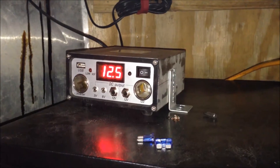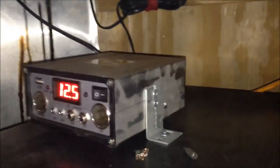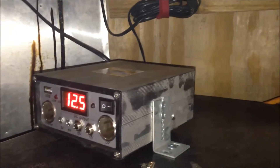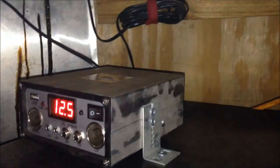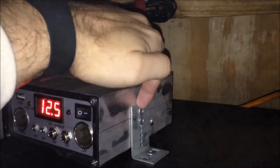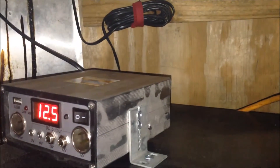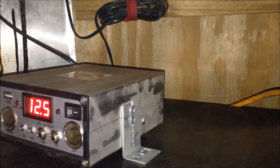There you have the generic charge controller. One thing that I did with mine that's a little different — you'll see here are the brackets. On both sides at the middle where the case splits, I just put some self-tapping screws through there and was able to not hit any electrical components on the inside. Now, when you drill holes in the side of the charge controller with those self-tapping screws, it will leave little shavings on the inside.